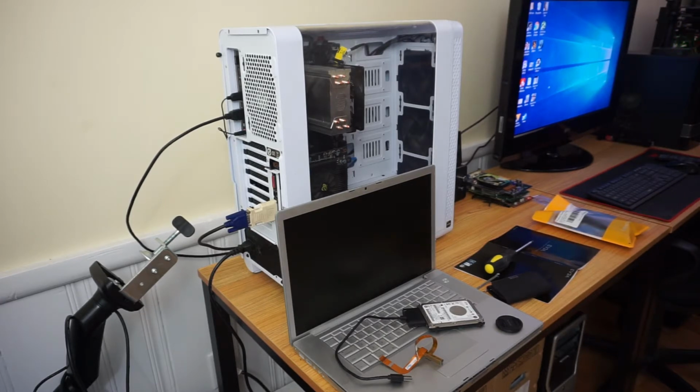This motherboard works fine with 16 gigs of memory, but I can't get dual channel memory to work. It's like half the PCI lanes are not working or something, like the memory lanes, I can't quite figure it out. And I can't get internal graphics to work. I've updated the BIOS, I've updated the drivers from Intel. Everything should work. It should absolutely work, but it doesn't.